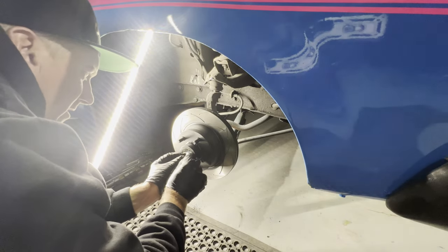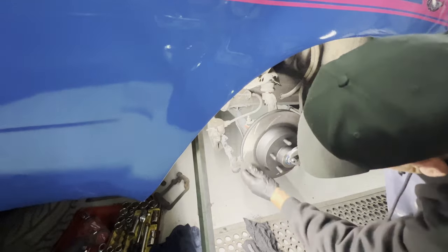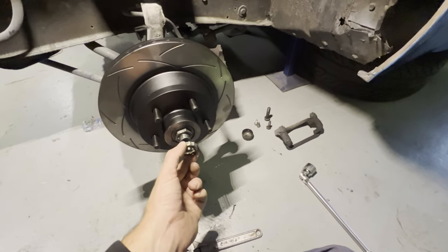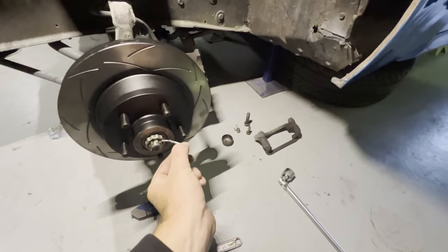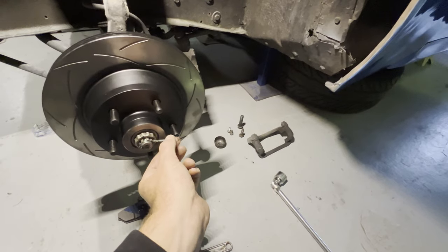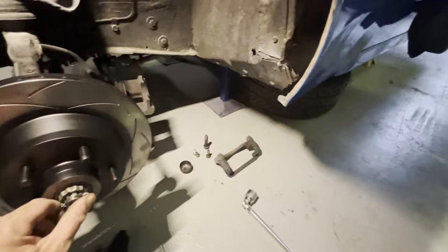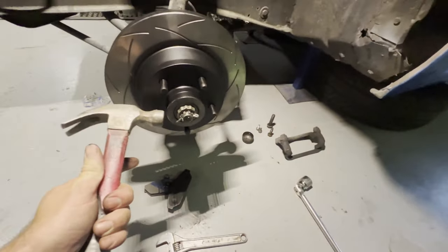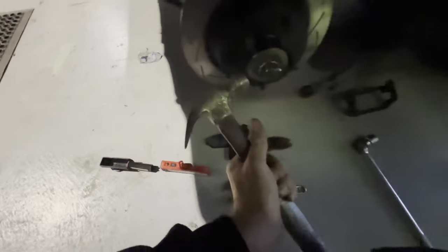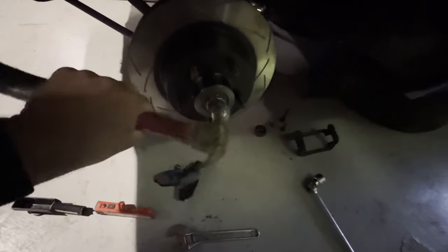I left the shifter and everything over the other side. So that's all tensioned up, took it back half a turn, and put our lock ring nut and our splitty in. Brand new split pin. And of course my rags are over the other side, and I've lost my torch and the battery. It's all happening, ladies and gentlemen. Alright. Bang that on.